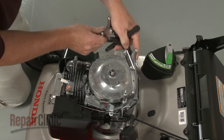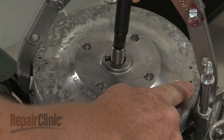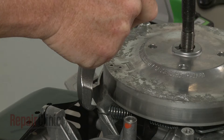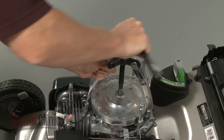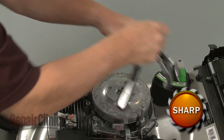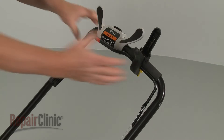You can now use a flywheel puller to help detach the flywheel. The flywheel has markings to indicate where the puller arm should be positioned. We recommend using a business card to protect the magnet. Once the flywheel has been removed, release the bail arm.